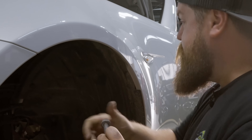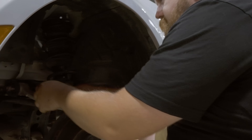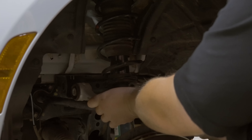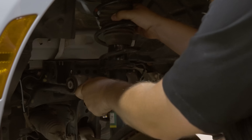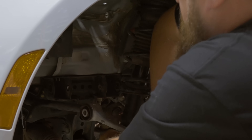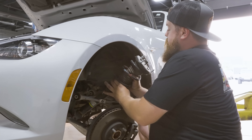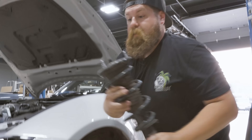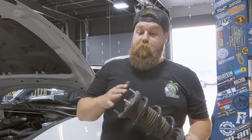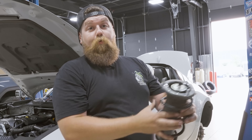Put the hardware back on the thing and then you don't lose it. Now we're gonna pull it down and then pull the hardware out of the control arms that we left in there, and then pull that control arm out. We should be able to get this low enough to carefully get the bottom up and over and pull out the stock strut. Now in this particular application with this particular set of coilovers, we do have to transfer over the top hat. So we're gonna put this thing in a spring compressor, undo this nut, pull the top off, put it on the coilover, and then we're ready to go back in.